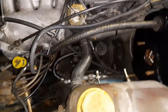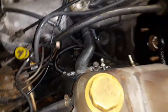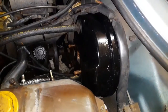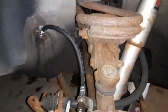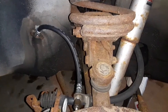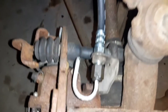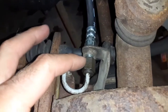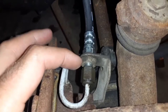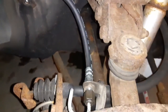The alternate booster is in. I had to swap over the vacuum line because it needs to be a bit longer on this car to reach the manifold compared to the '86 where it came from. Got all four bolts back in and the linkage to the brake pedal connected with that pin. I also took the front wheels off and installed new flexible brake lines because the original ones were looking pretty nasty — I think they were original to 1980. With the reservoir off, I was able to get those out without too much fluid leaking. The fittings are 14mm and 17mm flare fittings, same on each side.